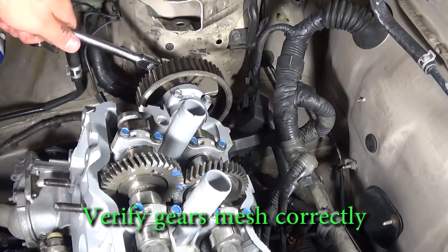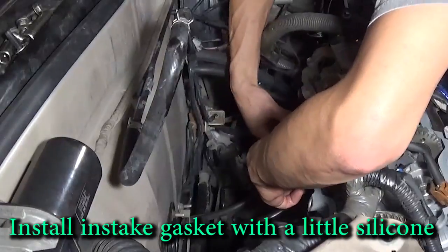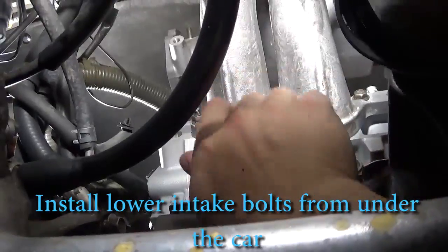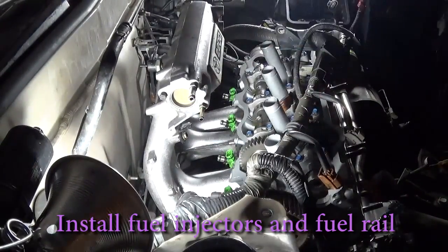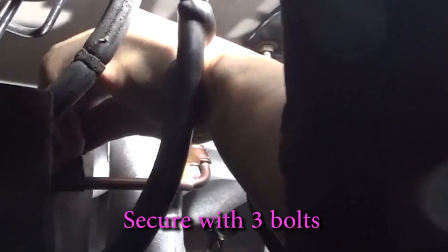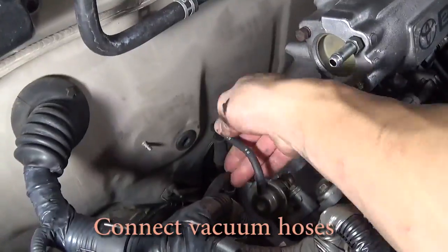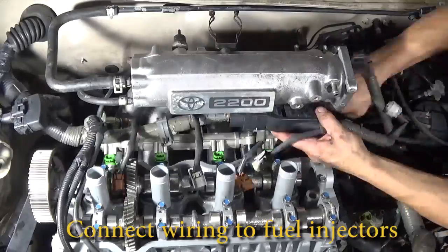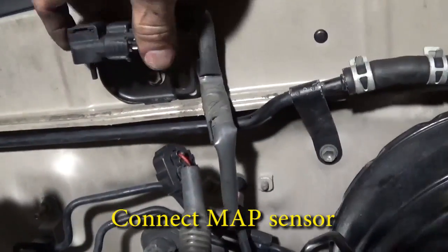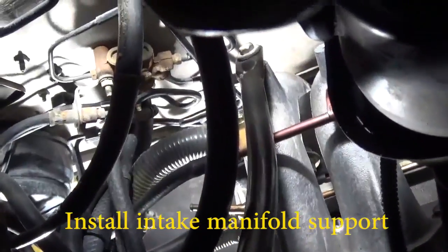I'm going to do the intake gasket — a little bit of silicone is what I like to use so it'll stay in place. Install the intake manifold. There are several bolts on top and two bolts that you can install from underneath the car. Install the fuel injectors and the fuel rail — that will take two bolts. Install the vacuum hose and pipe behind the intake manifold; there are three bolts in the back and two of the lines go into the power steering pump. Connect the other vacuum hoses and feed the wiring harness back into its proper position. Plug in the knock sensor on the backside of the block and connect the MAP sensor — there's also a vacuum hose here. The intake manifold support goes all the way to the bottom of the block by the oil pan — don't forget this part.